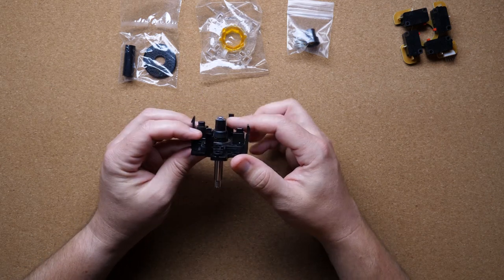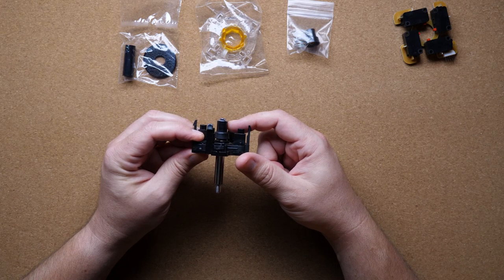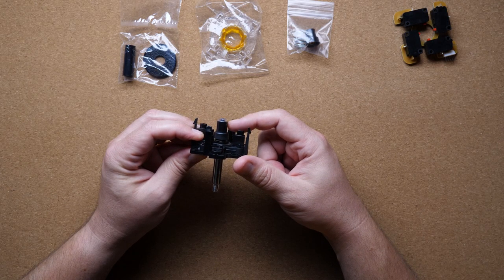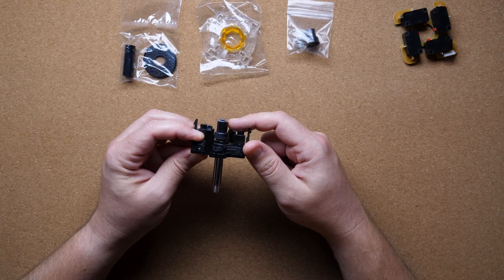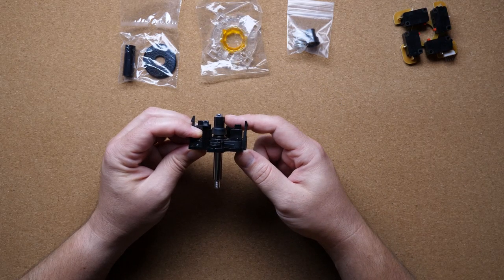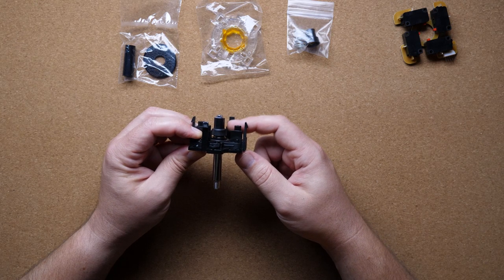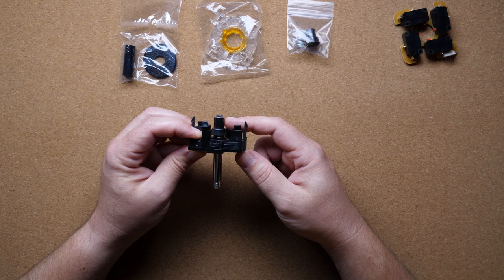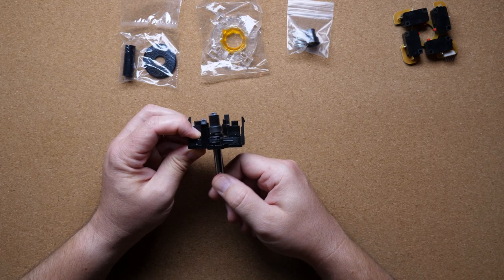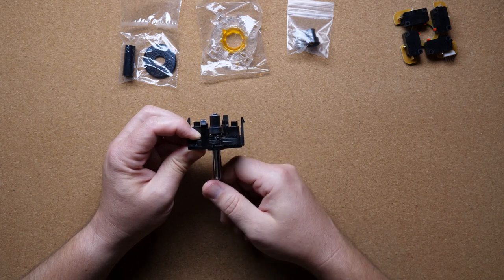But what you have, this big piece of black plastic here, is called the actuator. And the top part of the actuator, the thinner part up here, is what pushes up against the gate. And then you see it flares out down here, and that's the part that actually hits the micro switches. So what we're going to do is put an actuator in here where the top part is wider. And what that's going to do is make it a slightly shorter throw joystick, which I like better.